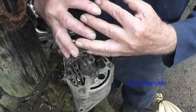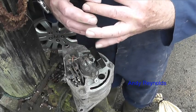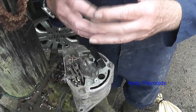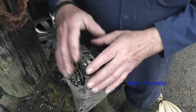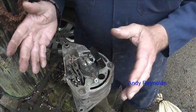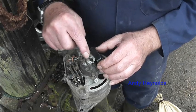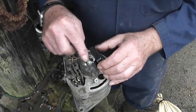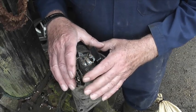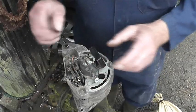The carbon brushes make the rotor into a magnet — there's a magnetic coil inside the rotor. The rotor has fingers like that, and it spins with the coil inside, so we get positive one end and negative the other: positive, negative, positive, negative, positive, negative. That's a magnet spinning past coils, which would be the stator — the outside of the alternator — and that creates electricity.